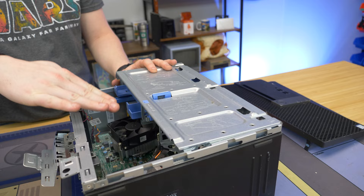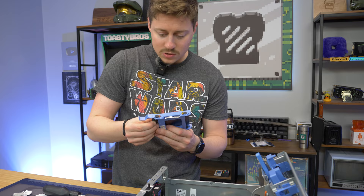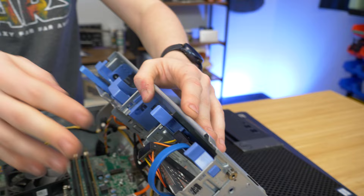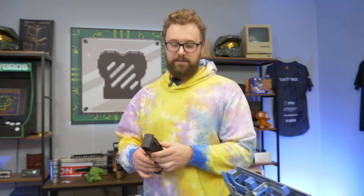With a bigger case like this, you don't necessarily need to have an RTX A2000 — the real benefit is it's a compact card. The beauty is you don't have to do any weird adapting for the six-pin for a card that requires external power. These cases are really cool because look how they cut this out — you can actually fit a full-height, usually two-fan card. We've actually done the same build with a 6600 and it fits a full two-fan 6600. We have a Patriot 240 gig SSD, just a 2.5-inch drive. Let's go ahead and put this in hard drive bay one.